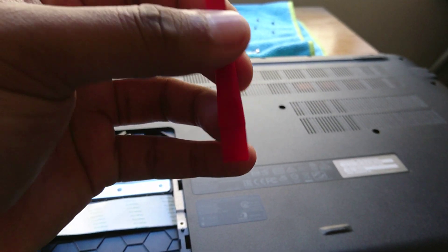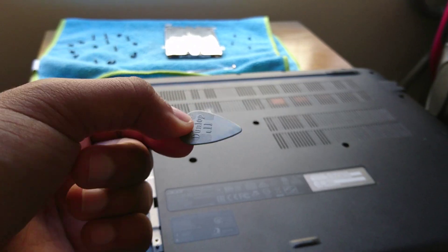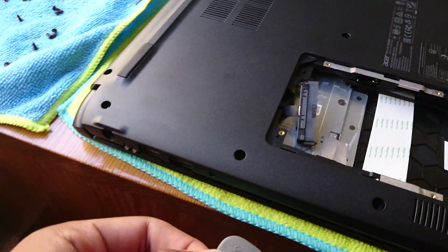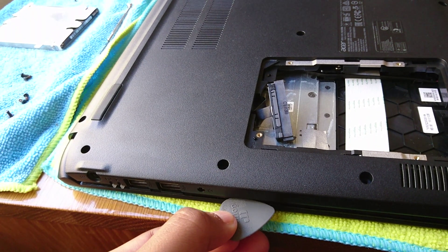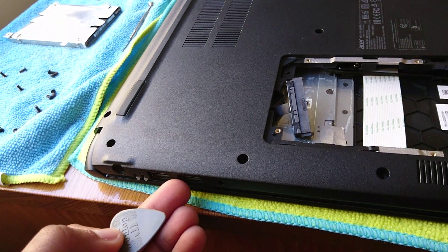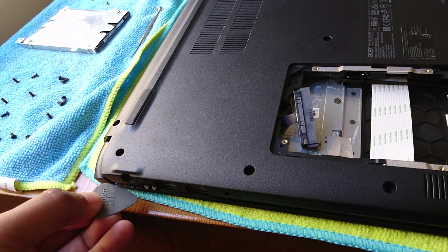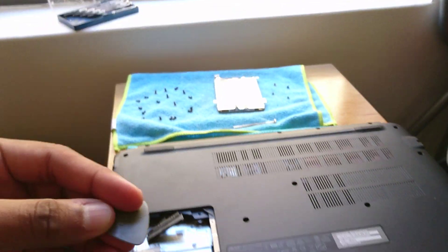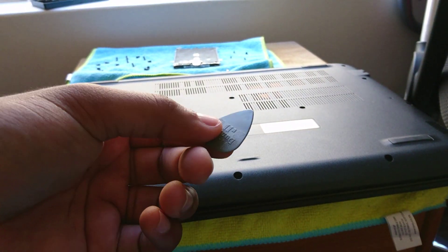It was very difficult for me to use that, but the best tool you're going to need is this one. If you look on the sides — sorry for the shaky camera — this has to go in between there and you just slide all the way down. There is a curvature on this side with the USB ports and lights, so just be very gentle and pop open from this side and work your way around so you won't break any of your clips, because that can happen.